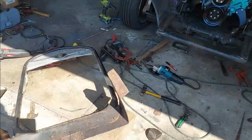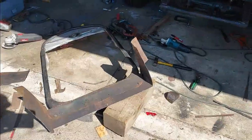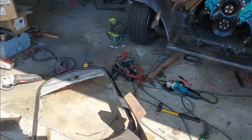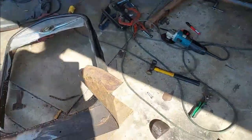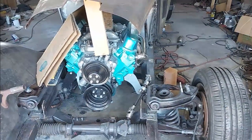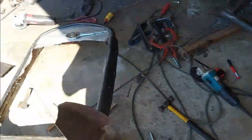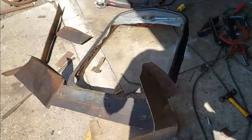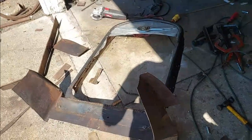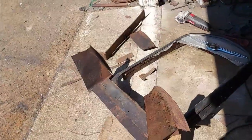This side curved in quite a bit when I got those dents knocked out of it. You can see it's supposed to go out to the outside, but I've got it coming to the inside quite a bit. So I think what I need to do is put this bottom piece back in the frame here, get it sorted out and straight, then put the radiator shell in, and rather than try to bolt it, weld it. But anyway, I'm gonna try to get this fixed up here — this bottom shell.